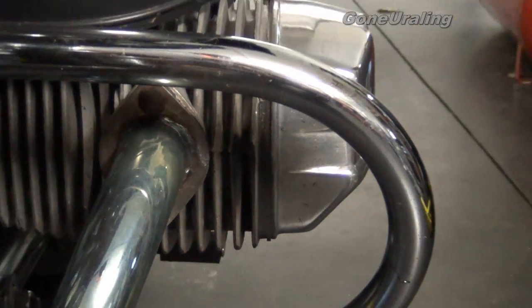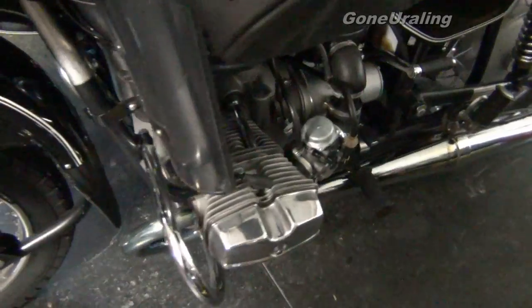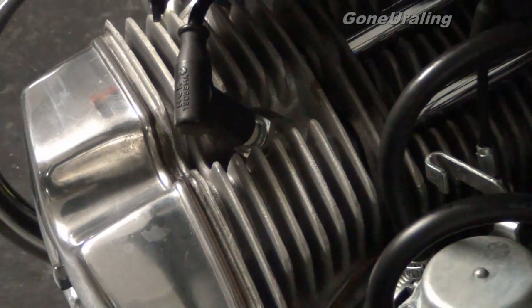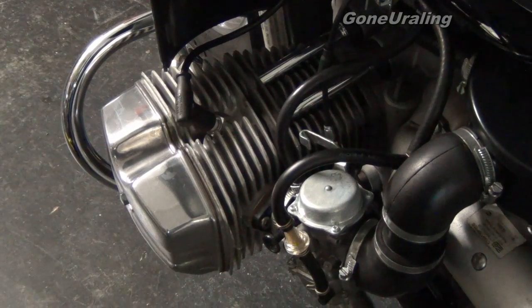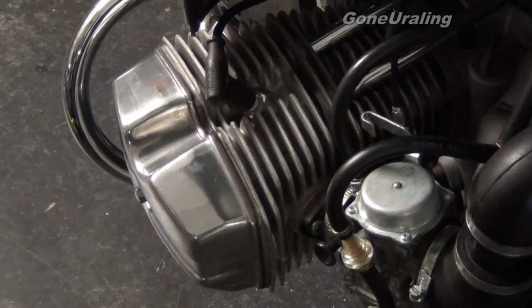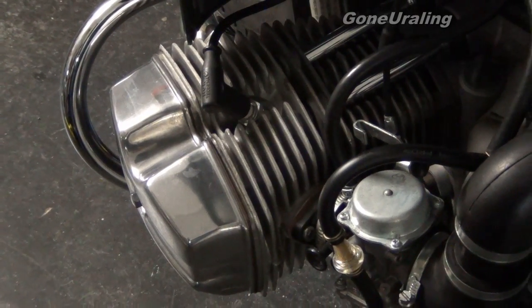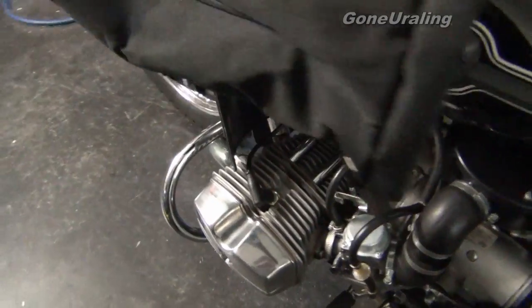So today, just to be cautious more than anything, I'm going to do a quick compression check to make sure the compression on the cylinders is good. I'm going to take a borescope, go inside and look around, see what kind of buildup we've got, and I'll probably adjust the valves on the left side, especially depending on what I find. If everything looks normal and it's just buildup loosening the valve seat, the specification is .004 — four thousandths of an inch gap — and I set those on both sides. But if I find it's not seating completely, I may bump that up to five thousandths of an inch tappet gap and run some Marvel Mystery Oil through it to try and clean out any carbon buildup, and just keep an eye on this to see if it comes back.